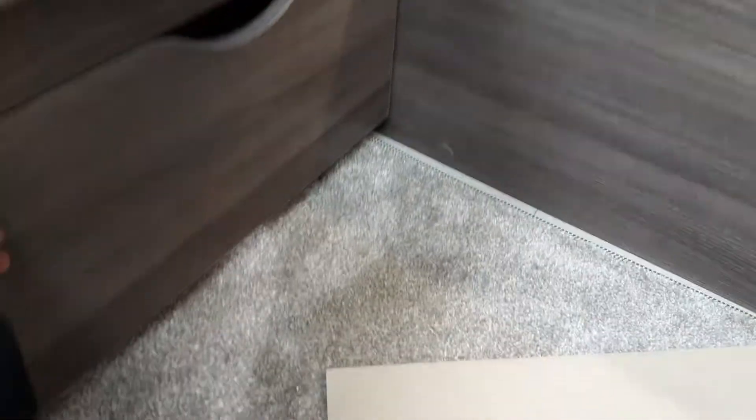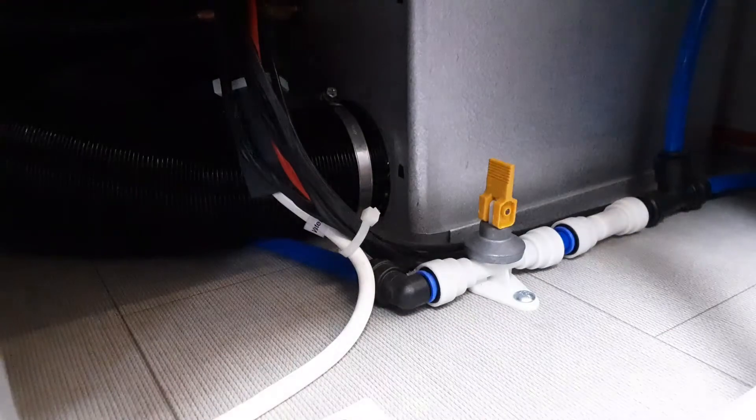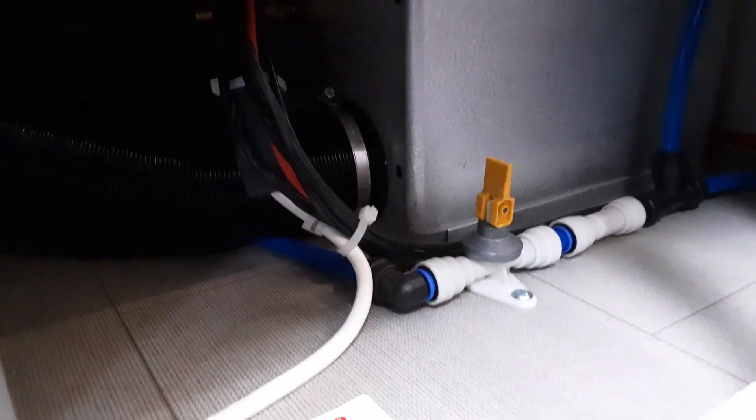Down the front of the van, you will find your hot water tank. To drain the hot water tank down or to fill it, you've got this valve just here. If I open that up, that will drain the water out of the system. If it's shut, you'll be able to fill the system. So this position is fill, and the raised position is empty. I'm just going to drain that off now.